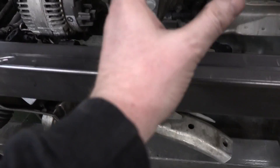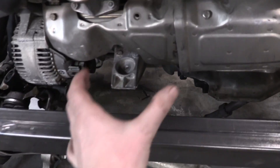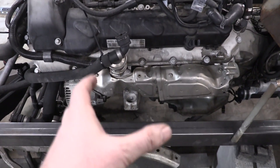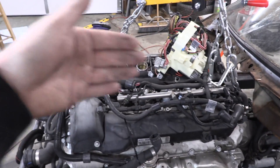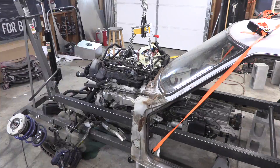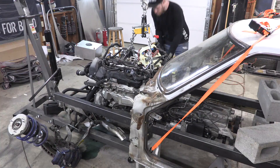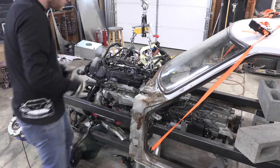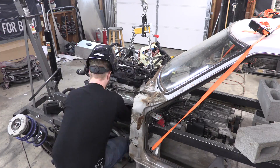Once we're 100% sure where we want this thing, I need to take that triangular piece, center it based on the mount, and tack weld it into the frame. Then we'll bring in our engine mount shelf and tack weld that on as well. I want this side of the engine supported by the mount first, then go over to the other engine side, level it completely, and tack weld in the other side before we pull the engine out.